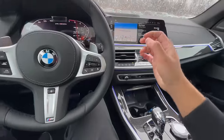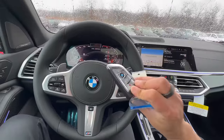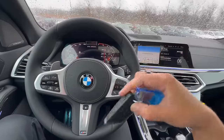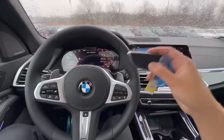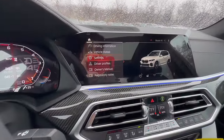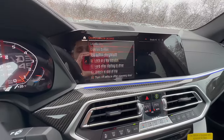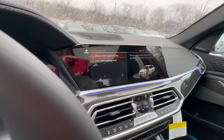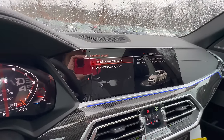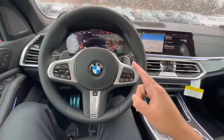The next feature is comfort access. If you don't know what comfort access is, it pertains to how the vehicle's doors can unlock themselves. By default, you have to enable this inside the system. When your BMW senses your key fob getting really close to the car, it can unlock the doors by themselves; and if it detects the key fob walking away, it can also lock the doors by themselves. Go into Car, then Settings, then Doors and Vehicle Access, and you'll see Comfort Access — by default it is not checked on, so go in and enable it.